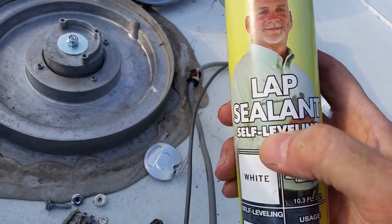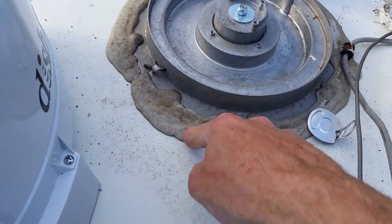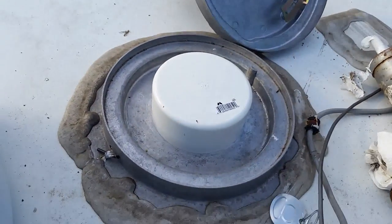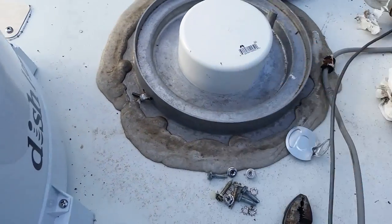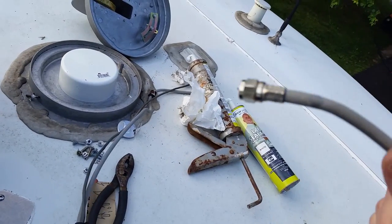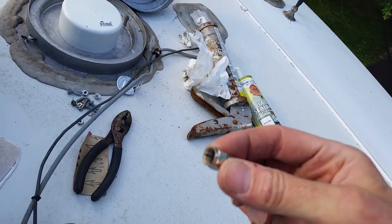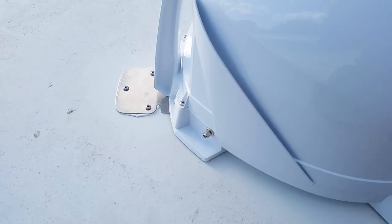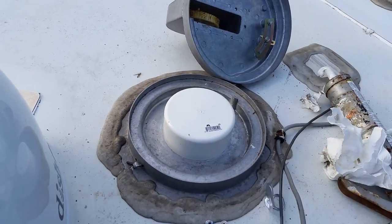I've got this cleaned up real good and here's Dicor lap sealant - really good stuff. This is the same stuff that was put on the RV back in 2005. See how strong it is - it's still there, stays soft and pliable, keeps all the water out. I'm going to lay a big bead around here and sit this cap on it. Also, I was going to talk about these cables. Luckily I can use my original cable - I've tested the signal and I get HD channels with it. But this connection is critical - any connection on these satellites really needs a good clean connection to get your HD channels, a lot more than what you have to deal with in your house.